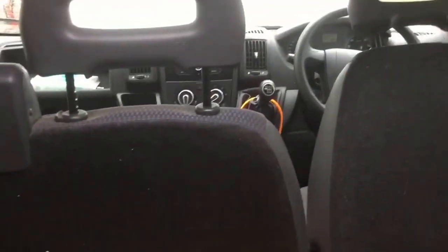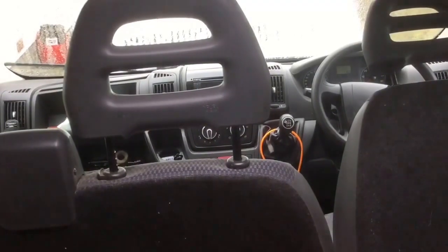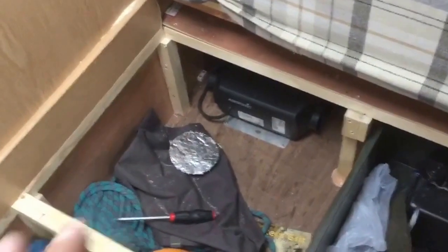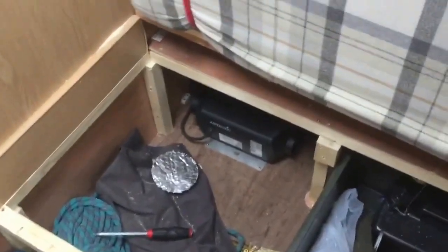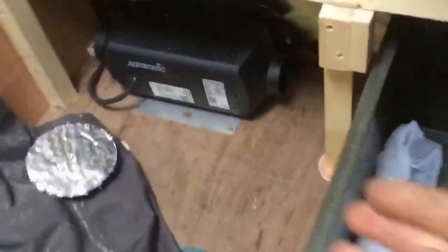You can just, if we listen very carefully, hear a clicking in the distance. It's very hard to make out, but that's kind of what I was looking for. In turbo mode, which is what this is heading to — the highest power setting — it's quite a loud unit. Once the seating's on top and it's boxed in a little bit, the sound will be a bit reduced. With my timer, I have it come on at about 2 in the morning just to reheat the van, and I tend to sleep through it now. It sometimes wakes my girlfriend up, but yeah, definitely not a problem for me.